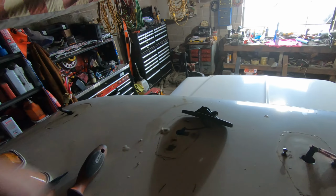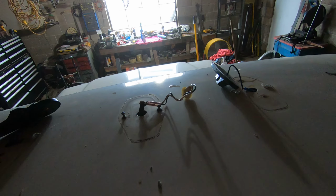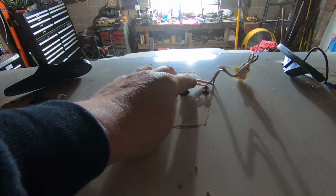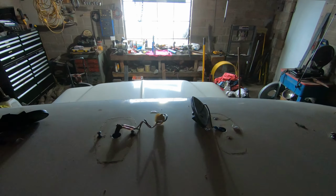Wow. Alrighty. So finally, it's been about 30 minutes trying to get these stinking lights off, and I don't quite have them all the way off technically. So one's there. These ones, okay, they're still on there. This wiring, the little pigtails and stuff. But here's the crappy thing. See these screws? Two for that one, and still one for that one. They're in a riv nut, which is good, but the riv nut itself is stripped out and it's no longer tight. So that sucks a lot.